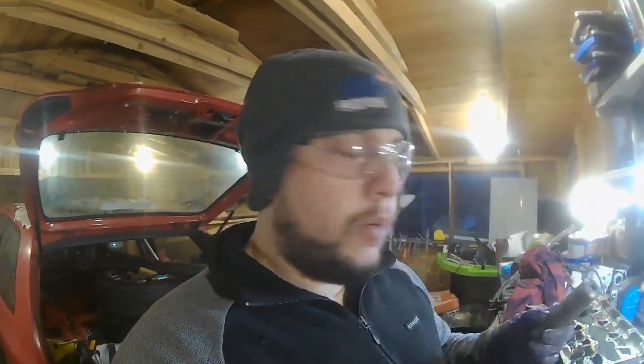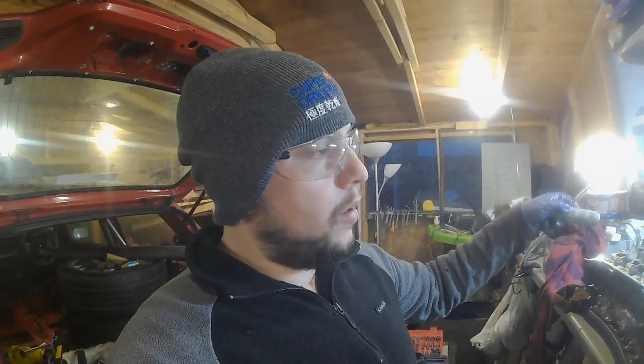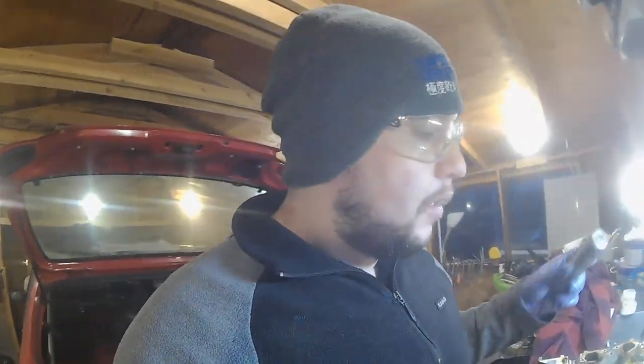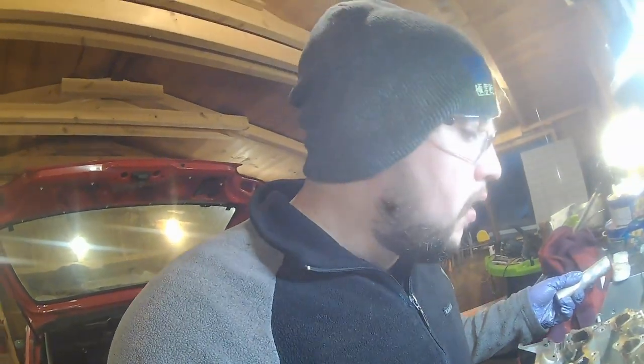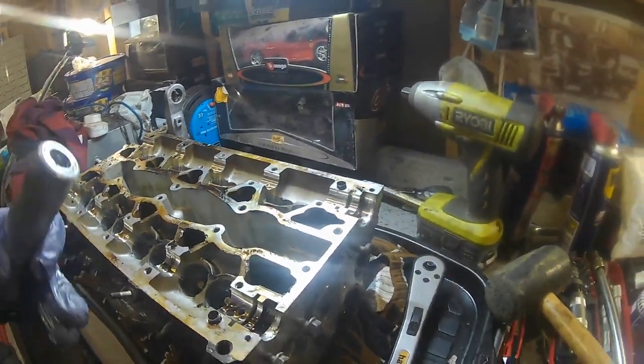So yeah, we're gonna bang out the rest of these, and I'll show you what I've done when I've taken them all out, and then we can hopefully flip the head. We push the exhaust valves and the inlet valves out the other end, and we can take them off and start cleaning them at some point, but that'll probably be on another video. So like I say, you probably won't want to see that, and I'll probably leave that for the next video anyway. But yeah, that's basically me stripping the head, guys.